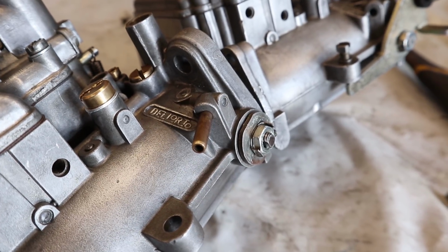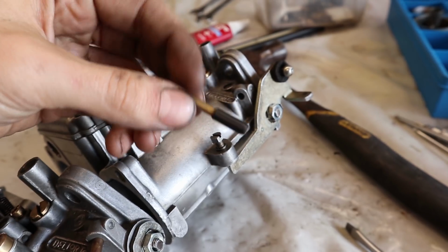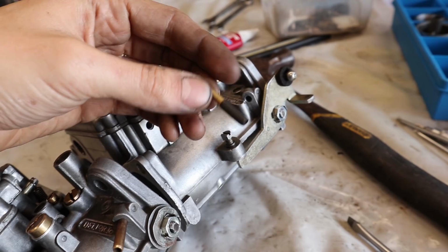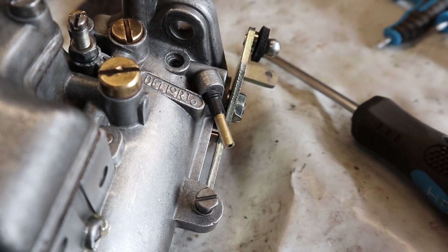A last issue I needed to address was that one carburetor was missing the fitting for the vacuum port. At first I didn't think much of this, but it is quite possible that this is the reason why my other carb is pulling more air. I MacGyvered a fitting that came off another carb that I had lying around, so that we can give it a try.